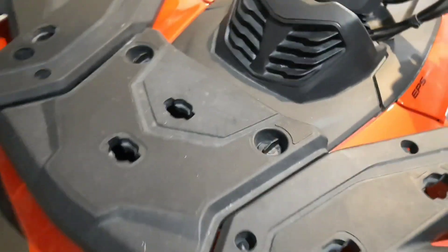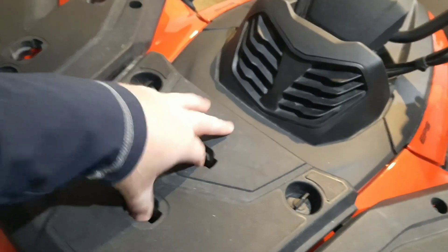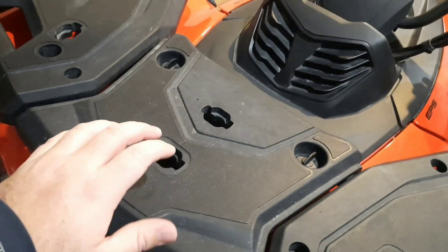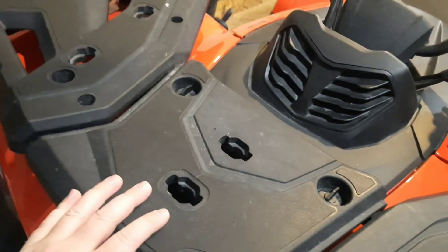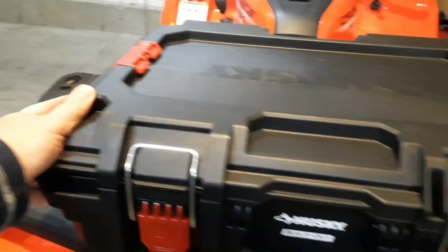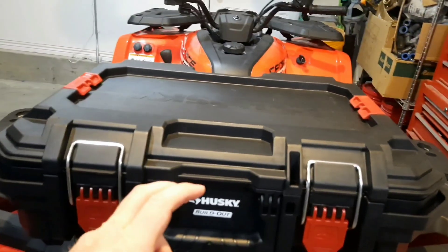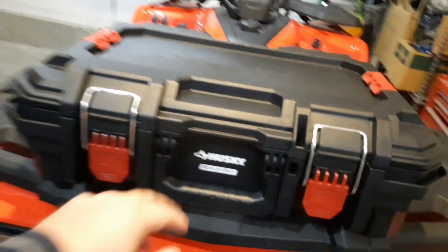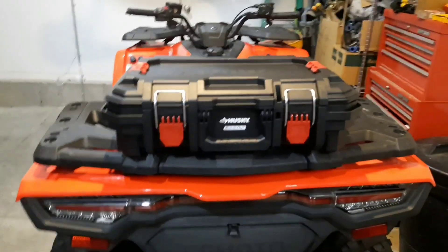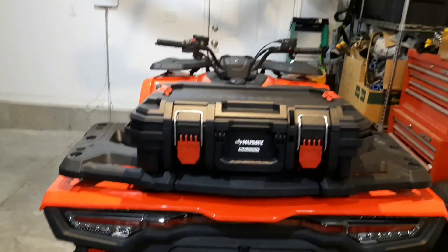The racks on this CFMoto are identical front to rear, so these are the mounting points I used. I kind of jimmy-rigged a mounting system. But I'm kind of regretting putting just the two center bolts — I should have done maybe some sort of triangular pattern, because I think it would have held on a little bit better. If I really start to pull on it and twist it, it does move a little bit. But I think that's mainly just the plastic twisting, because the plastic really isn't that thick — I drilled through it and it's only about 3/16-inch thick.